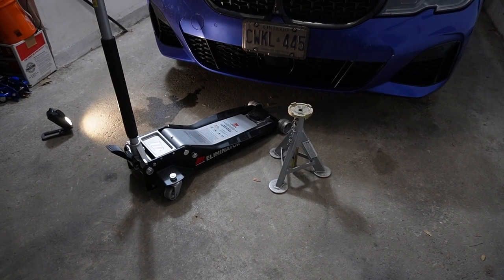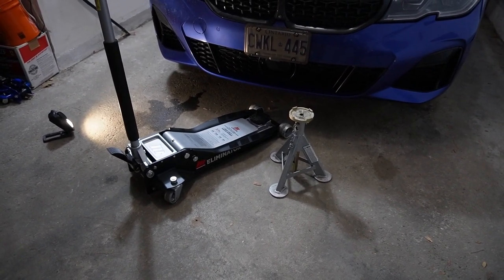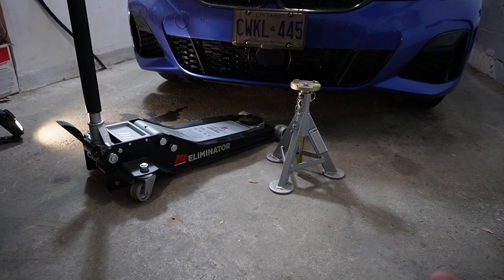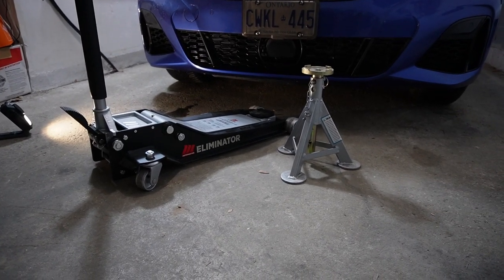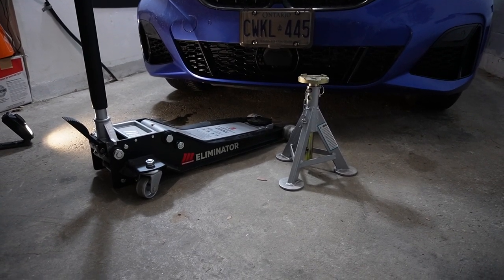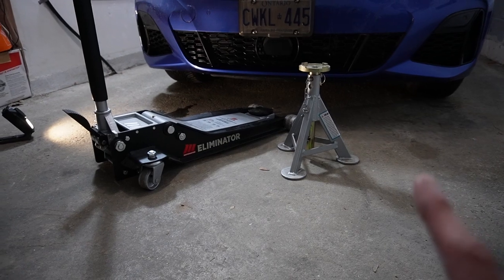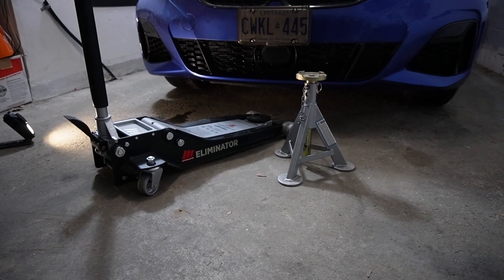And that's it for this video — a relatively short one to showcase how to use jack and jack stands together to lift the front and rear end of your vehicle. Alternatively, you can use stacks of two-by-fours to lift the vehicle eight to ten inches off the ground if you don't need the wheels off. I hope you enjoyed the video and have learned how to operate jack and jack stands, and learned more about the BMW G20 chassis lifting points if you have one. If this was helpful, please give it a thumbs up and consider subscribing as I'll have more content about working on my BMW. That's it for now — catch you in the next one. Cheers.